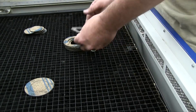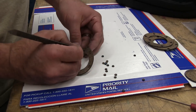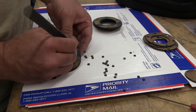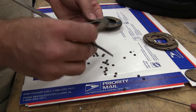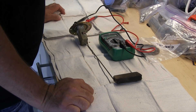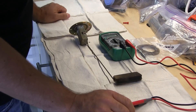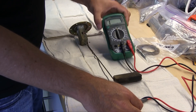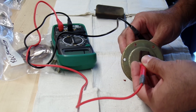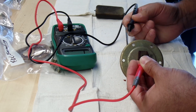These gaskets came out pretty good. As you can see, I'm making many and I'll make them available to other Mazda RX3 owners — I'm going to sell them on eBay. I'll put a link to eBay in the YouTube description down below. So what we have here is a fuel sending unit for a Mazda RX3 — it's a '76, a 38-year-old fuel sending unit and float. I'm going to test it: one lead to where the vehicle plugs in, and the black lead goes to common ground.